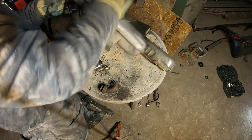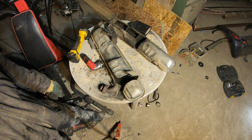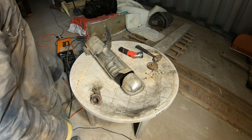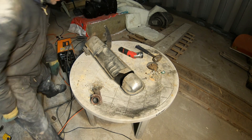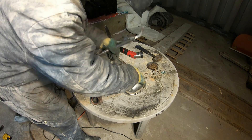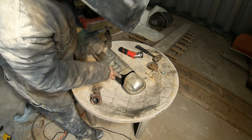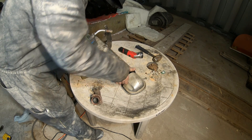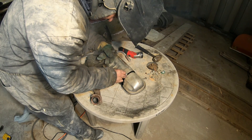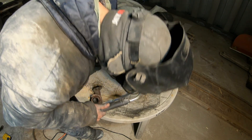This one didn't get rusted out like the other one, but the catalytic converter plugged up. Very thin metal — I already tried welding it some. Gotta turn down the amps and crank up the speed. It's like welding a pop can almost. Keep those two halves together — one thing you could do is just squeeze them together and then tack the side. Just like that. That'll ensure they're getting welded at the same time.